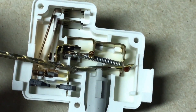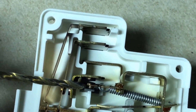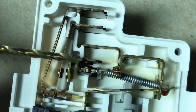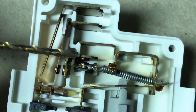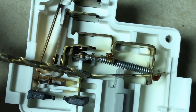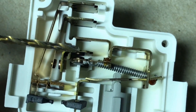As you can see, the connection to the neutral line is broken, and then this contact switches over to where the machine input is connected — and the machine input always has line voltage. So when the plunger is depressed, the neutral is disconnected and the motor is then connected to line voltage.